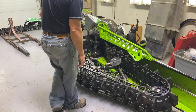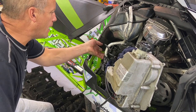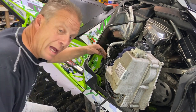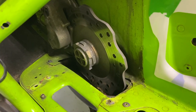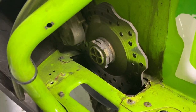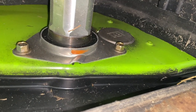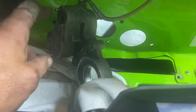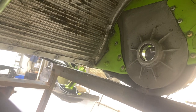This is probably the easiest way to get a skid out of this sled. Take the chain off — that's easy on these Cats. Then pull the snap ring off, no problem. Now we've got to take these nuts off in order to get the brake disc off, and those bolts have to come out to get the brake caliper off. The only way to get it off is to split this baby. Other than that, it's not too bad — that shaft pops right out of there. I didn't have to take the chain case off.